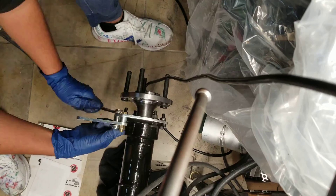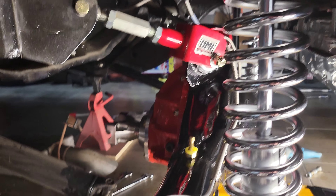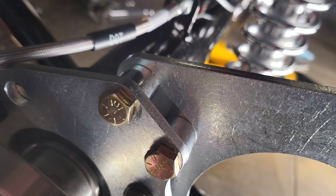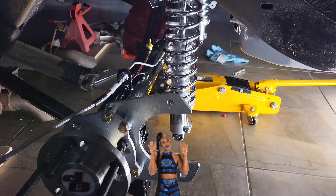What I did was take this off the 12-bolt and welded a nut on the housing so that it now bolts up — that's for the center splitter. I bought these from Summit, but everyone and their mom sells the same kit. This is just a 12-bolt kit and I bent it, cut it, and flared it. These little splitters I got — a 3/16 to dash-3 — and then I bought a braided line for the length I needed. I believe this is a 12-inch line.